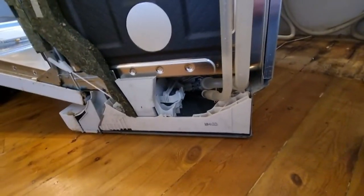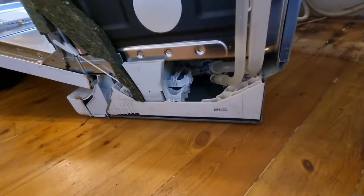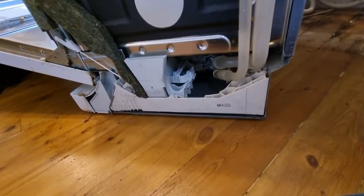On the right side you've got access to your heater. You can test your heater through here pretty easily just by getting your multimeter probes in there. You've also got a better look at the base, so if you are getting water building up inside, this is the ideal place to look to see if it's building up.